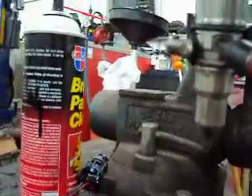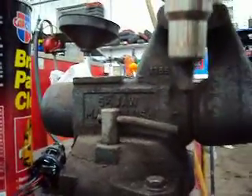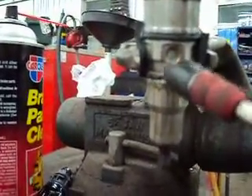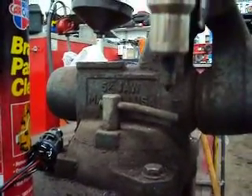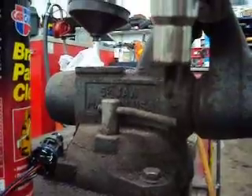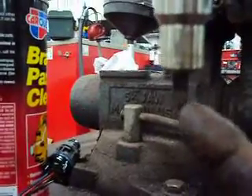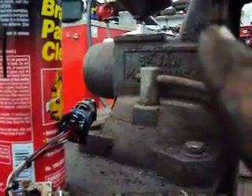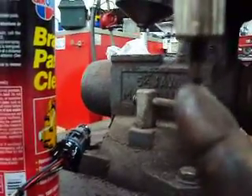So what I did was put the bad injector in the vise, sprayed a little bit of brake cleaner where the fuel would normally go, and clamped off the other two holes. I'll put some air in through the screen where the injector is, and we'll see that as I apply the air, you can see the fuel squirting out of the tip of the injector, and there is a hairline crack right along the edge here.